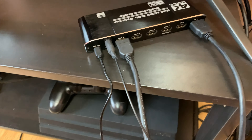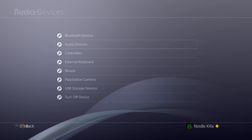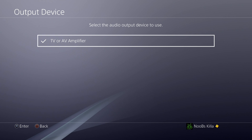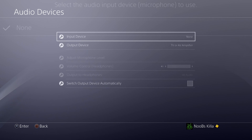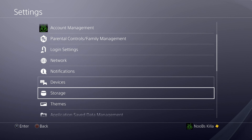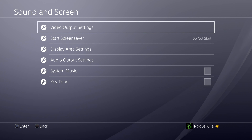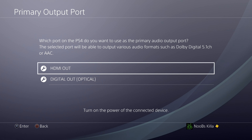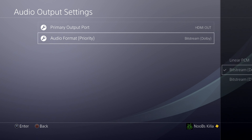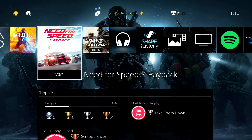The only thing you need to do is go into the options, go to audio devices, and over here you're going to choose what you need. I have it set to TV on amplifier right now — this is on the PS4, I don't know exactly how it's going to be on PS5. Also in the sound and screen settings you're going to have an option to choose audio options. You will not have digital output optical; you're going to have HDMI out. This is probably how it's going to work on PS5, and you're going to choose Dolby as the standard for audio.